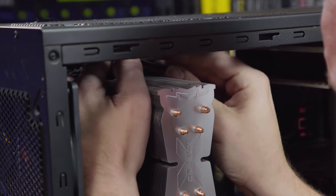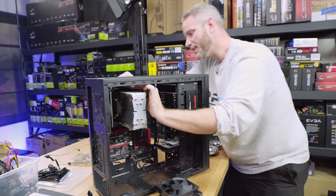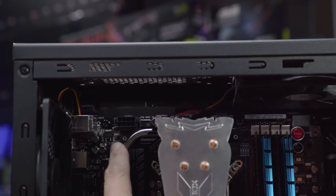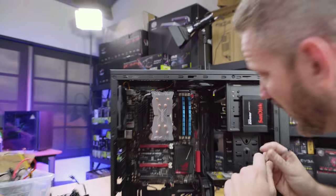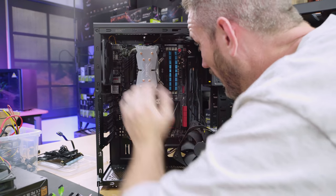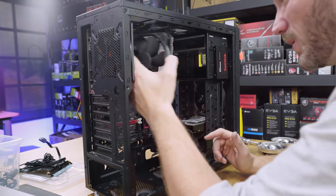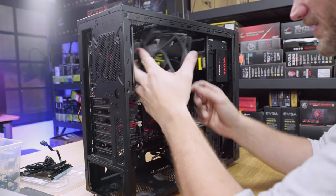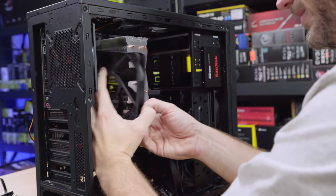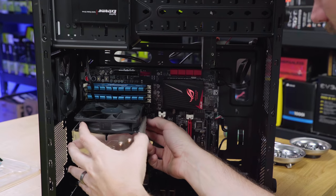The other thing was the CPU fans — each fan was plugged into something different, so they weren't running at the same speed. You'd have one fan blowing harder into the other fan, not letting air out, which was just counterproductive. I ended up taking off the top fan to have better access to the 8-pin EPS power and the fan headers, because this case — although a good case — is from before they really gave thought to having room for radiators, top fans, and room to get your hands in. Now I've got both fans plugged into CPU Optional and CPU Main headers, so they'll actually work together. If you get triggered by emblems being upside down — unfortunately this one has to be upside down.